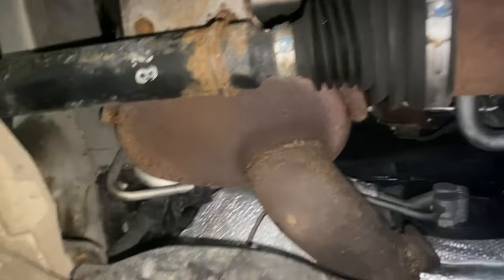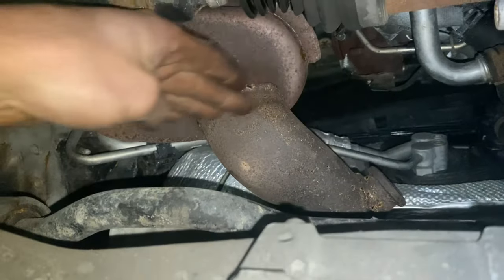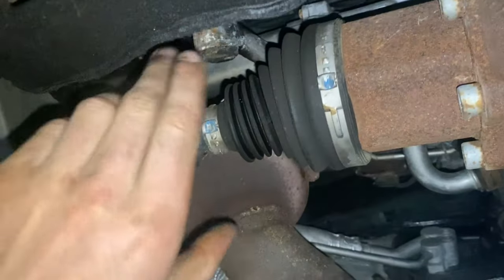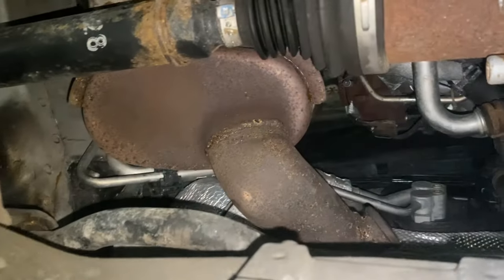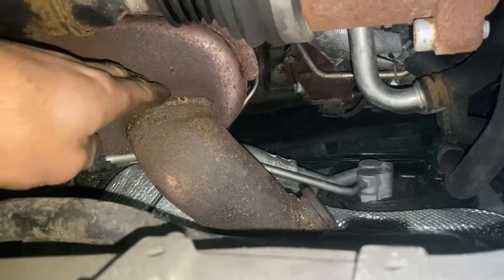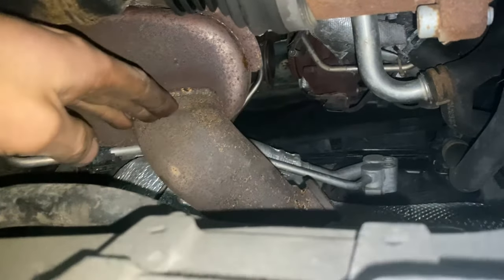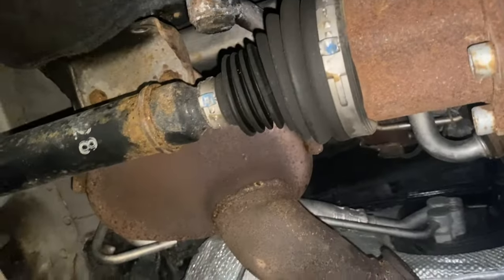The life of a criminal would be a lot easier — you could hypothetically cut here, take the drive shaft out, and the DPF would just slip straight down. The issue is the DPF would only be scrap value; you probably wouldn't be able to use it as a core. So you need to keep this tail end all together with the DPF, which means going out through the trans tunnel — which kind of sucks.